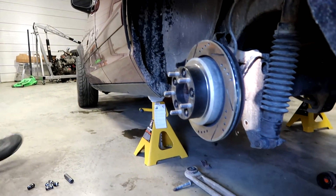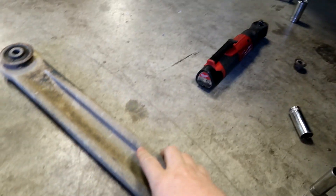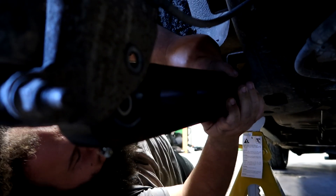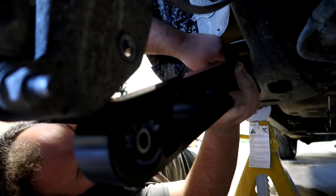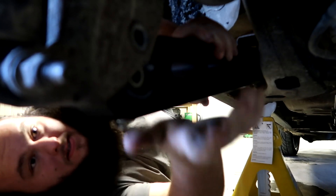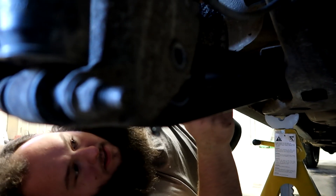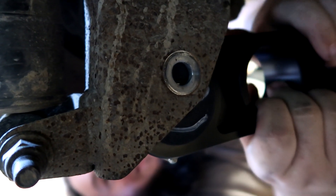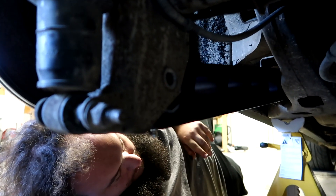It's some worn-out bushings compared to some new polys. All right, so Will's gonna put some of the supplied lube — lubricant, grease, whatever it is. Lithium, I think? It's Energy Suspension. They supply the grease for you so you don't have any kind of noise from the bushings rubbing on the actual metal while you're driving down the road. That went in way easier than I thought it would, honestly. Let's pull it back down so he can rub that grease around. She's in there — she's got one way and that's up. She's in there for life. He went ahead and attached the supplied zerk fitting and greased them all up.